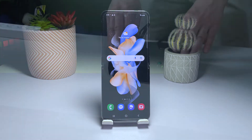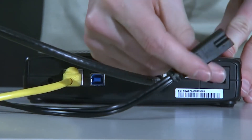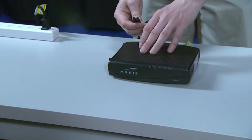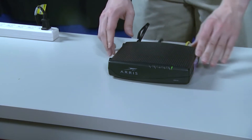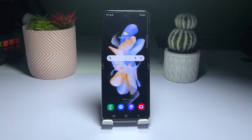Here's how. Unplug the power cord from the wall outlet or disconnect it from the main unit. Leave the network device without power for a minute or two. Plug the power cord back in or reconnect it to the main unit. Wait until the network device starts broadcasting the signal and ensure your phone is connected to it. Test if the problem has been resolved. This simple solution may resolve the disconnection issue and restore a stable Wi-Fi connection.